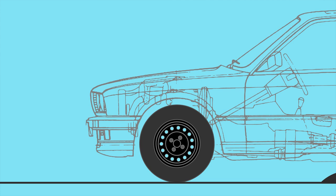The more unsprung weight you have, like heavy wheels and tires, the more of the small bumps and imperfections your tires will absorb. This makes the ride nice and smooth on the road, giving you those VIP feels. But that also means your suspension needs to work harder to keep those heavy wheels and tires in contact with the road. If you go over a big bump, a car with heavier unsprung weight might overwhelm the suspension and lose contact with the road, but the lighter setup gets immediately pushed down, keeping the tires in contact. It's also easier to turn and change directions with less unsprung weight, meaning better handling and more precise steering — though less unsprung weight also means more vibrations transfer to the cabin, making the ride a bit harsher. A small trade-off for the massive gains in traction and handling.